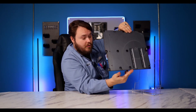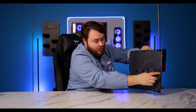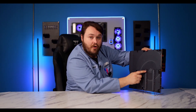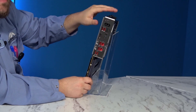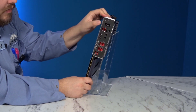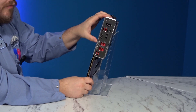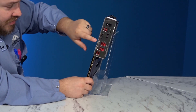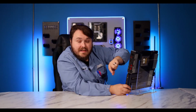If we turn the board over, you can see this large metal backplate, which has pass-throughs for your mounting points as well as the screws which secure into the PCIe slot on the front of the board. On the back, we have our Q-Flash Plus button, which allows us to flash a BIOS to this board without any CPU or RAM. We have Quick Connect Wi-Fi 7, two USB 3.2s, a DisplayPort in which carries video for our two USB 4 ports, line out, mic in, four more USB 3.2 ports, and two 10GB Ethernet ports.